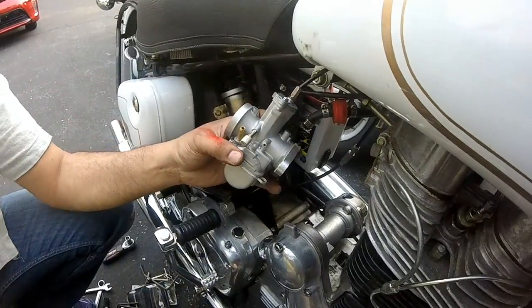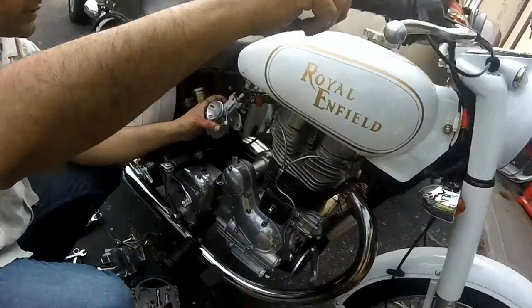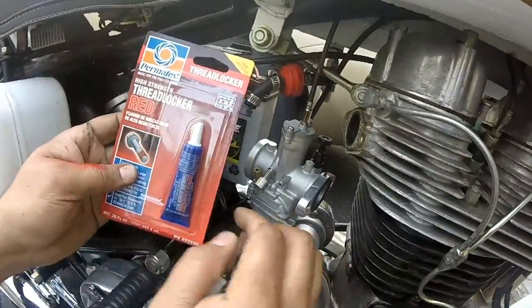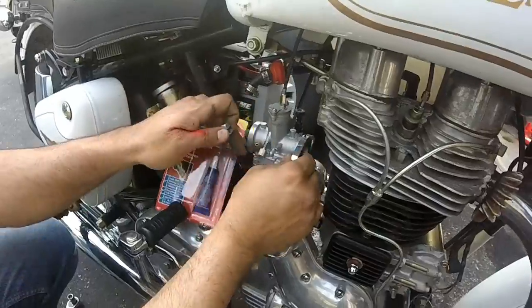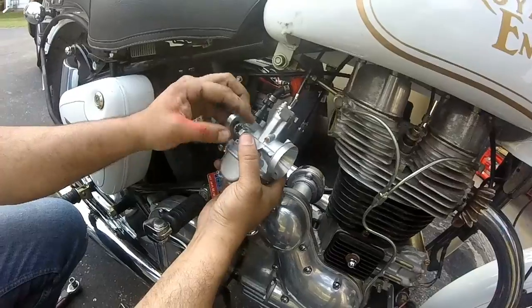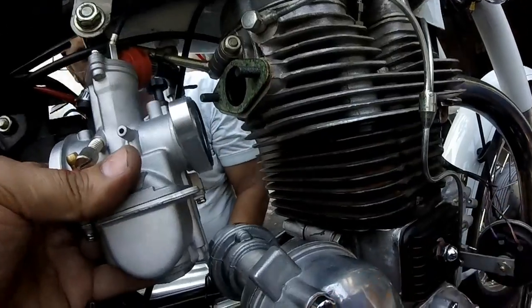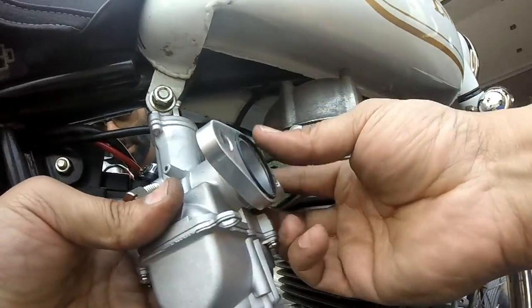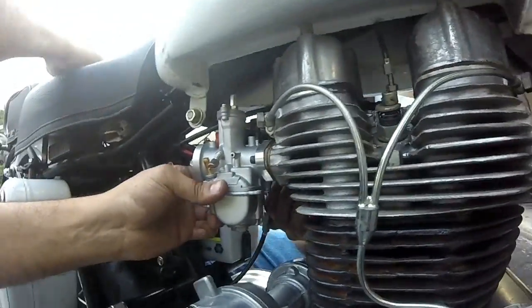We got the carb on here. We are going to check if it is free inside, and then we can twist the handle. Next thing will be to get the studs in here — we are going to put some Loctite on the studs over here and put these studs in here. The stud and the bolt are very tight on this side, so just leave only enough thread here, just enough for the bolt. We got the studs in with Loctite, and now all we have to do is put the carb on here.